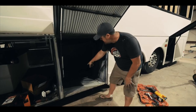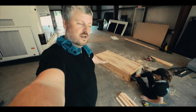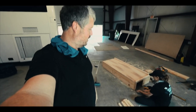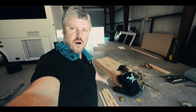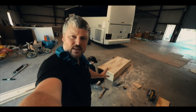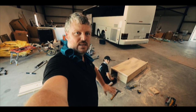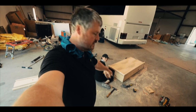What we're doing right now is building a platform down here for our gray water tank to sit on, so it's actually elevated and the water can drain down properly. There's a gap right there that's going to be access to where our water pump will be. Right here at this end, we're going to cut a hole and probably slide in a larger PVC pipe where we can store our sewer pipes and stuff like that to keep this area clean. Then I'm going to carpet this whole thing so it looks nice.